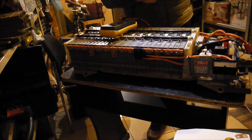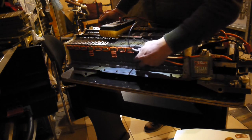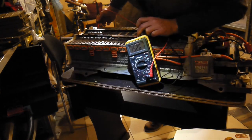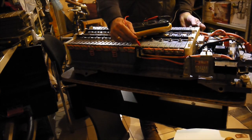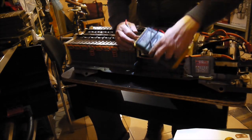Now I have some measurements to do. With the main fuse removed, the battery is split in two but I can still take readings. The multimeter needs to be on 200 volts DC. Taking a plus from here: we get 152 volts — that's the first pack. Then measuring from here to the minus end: 72.3 volts, which is perfect.